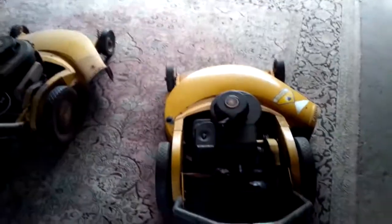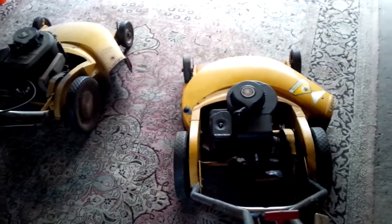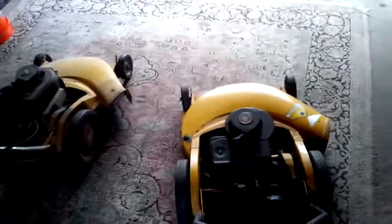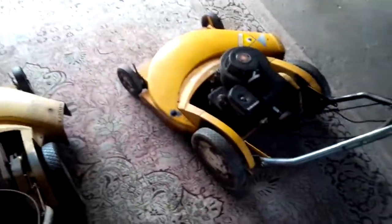And if you do come across one of these Hahn mowers, I'll tell you, they last forever. Especially if you know how to replace the engine. I don't know why they were replaced. The only real things that go bad on them are the points, and if the oil was drained out, they would seize. But other than that, replace the belts, grease it up, oil it up. These things run almost forever. They are like a cast aluminum.